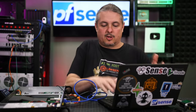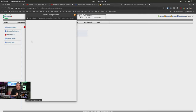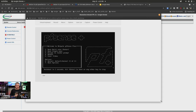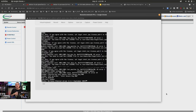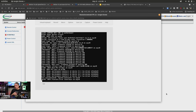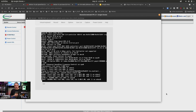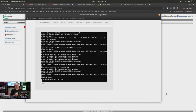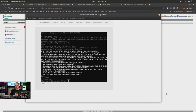Let's log into the IPMI. Now, this is your standard Super Micro IPMI with the HTML5 KVM. So if you're remotely working on this, not a problem - you can get in here and watch the boot-up sequence, get into BIOS, change any settings, even reload it if necessary, because it does allow connecting virtual media to it. So when you're in a remote situation and something goes wrong, or you accidentally locked yourself out of the WAN side, you can go over here, get right to the console, jump in, and be able to administer the machine and reload it.